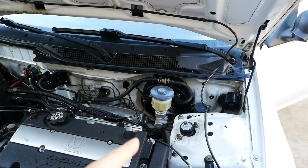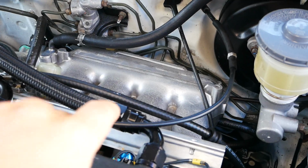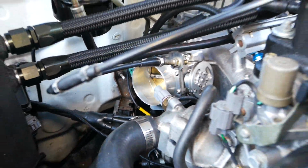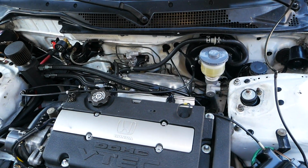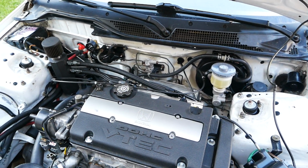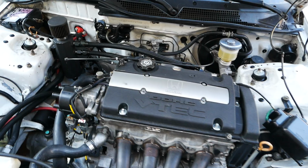Let's see, we've got a custom configuration that I did here with the brake system to make this fit. This is an RRC, not RBC, RRC, and that goes out to a 72mm K-Tune throttle body, which you'll see right here. So this guy is opened up, with added plenum volume, which you can see the welding right here. That was done by SBS Performance, Elvis Lee, who did a bunch of different port work on the inside. Really, the idea being to pick up a ton of torque on these motors, and somehow I got it to stuff inside this engine bay. So that's awesome. The engine overview.